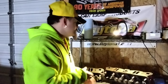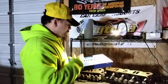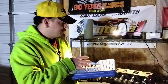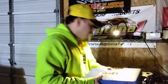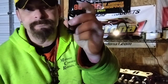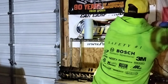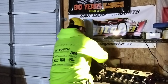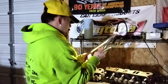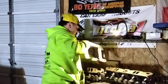When it comes to valve spring compressors, this one is by Orion Motor Tech — you can find these online. They're not bad, but they can only be used on low-tension springs. Anything upward of 300 pounds and they'll just crumple like a beer can, which kind of like these did, so make sure you know your spring pressure. For heavy-duty work, I'm using this Aries valve spring compressor — I love this one, except they're almost $200. But sometimes you just can't skimp on money and buy something cheap, because cheap doesn't always get you home.